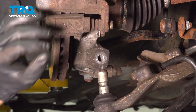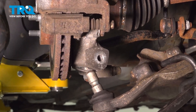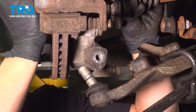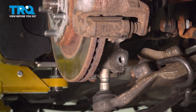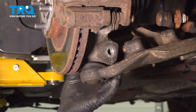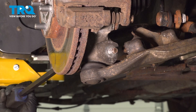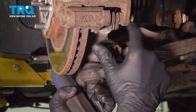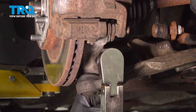Pull down on the control arm and make sure your axle splines are lined up. Install the ball joint bolt — you may need to tap it with a hammer. Install the nut. Using an 18 millimeter socket and wrench, hold the head of the bolt and tighten it down. Torque the ball joint nut to 46 foot-pounds.